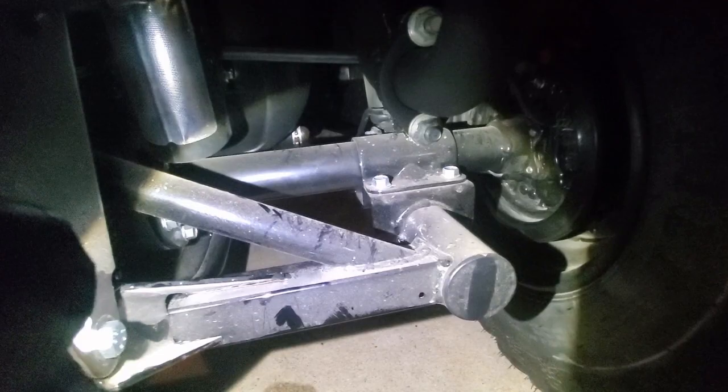And then the rear suspension on this thing, that right there is the frame. And then the frame has this weird bracket that comes up and over and then diagonal down back to the frame. I guess this isn't even the frame. This is like the swing arm, I'm guessing. And then the motor and everything is hard mounted to that. And then that little triangle that comes up, that's where your panhard bar is mounted to. And then that's mounted to the bottom of the bed, which I'm guessing this is the frame, not that. That's actually the swing arm. And it's a big old complicated swing arm because the motor and the diff is mounted to it. Kind of a weird little setup they got here.